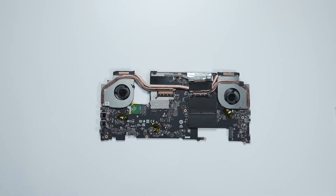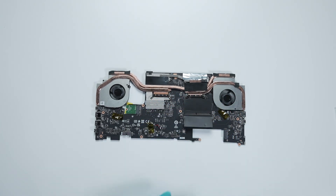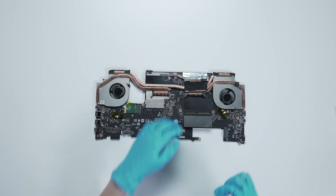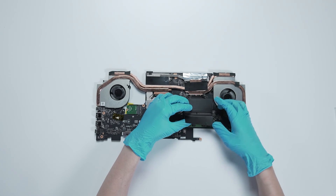Finally, now that the motherboard is removed, you will be able to see the two RAM slots. To upgrade the memory, press the slot hooks with both hands to release and remove the existing memory, then insert the upgrade memory into the memory slots at a mid angle.